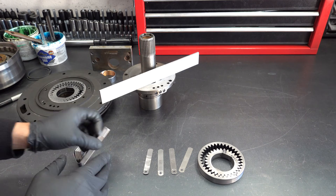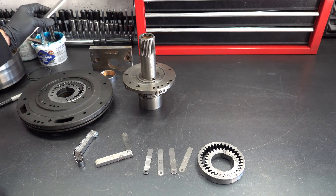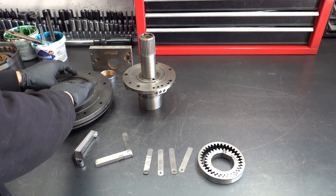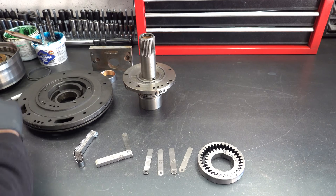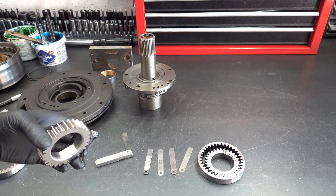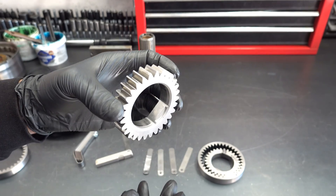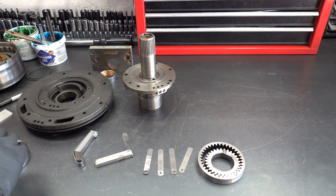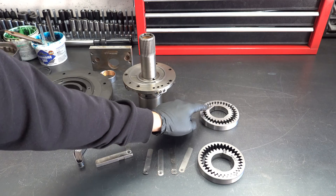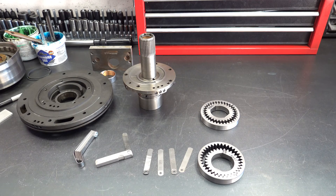I'm satisfied that this surface is perfectly flat, so there's no adjustment we need to make to the numbers that we took on the pump body. I'll take the gears out and get them out of the way. And incidentally, if you haven't observed already, these beveled flats face front, so when you go to install your gear set, you want to make sure that the flat side, where it comes all the way up to the top of the drive gear, faces you.